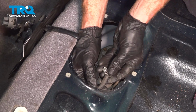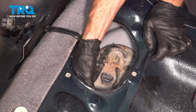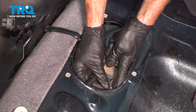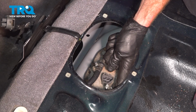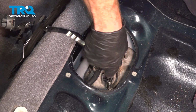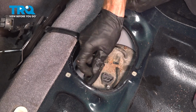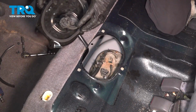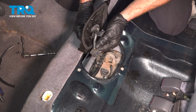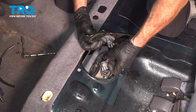We've got our next hose here. Slide this into position. Get the clamp so it's showing hose on both sides, of course. Tighten this up. Now that we've confirmed both of those lines are properly secured in place, it's time for our electrical connector and our protective panel. Let's get this electrical connector in place.